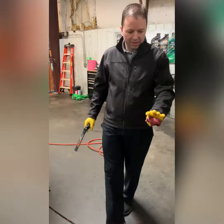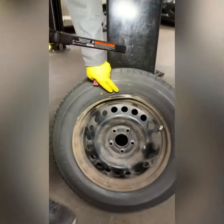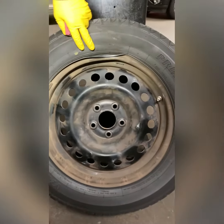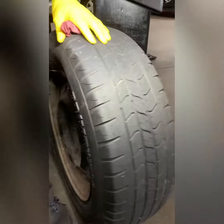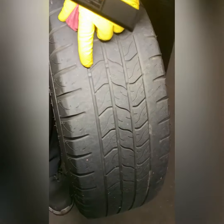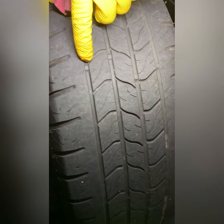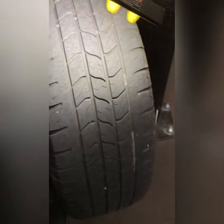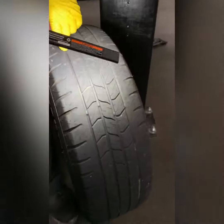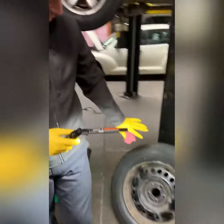To start out, we've got the right front wheel off. You can see it did bend the right front wheel. Strangely enough it is still holding air, but the wheel is bent. If you look at the tire wear, the tread is almost right at flush with the wear bars — once the tread is flush with the wear bars, that is the wear limit of the tire. So it wouldn't hurt to install two new tires on the front, and of course a new wheel.